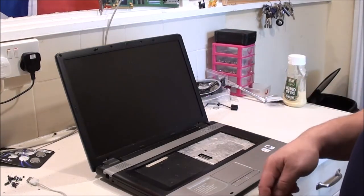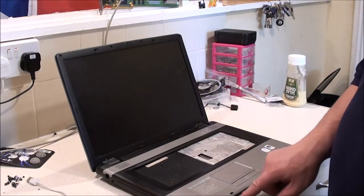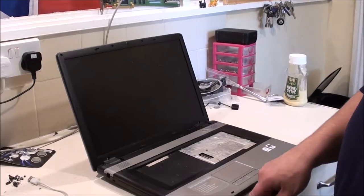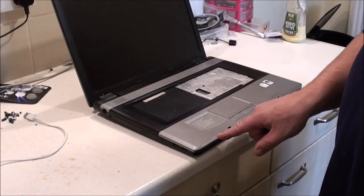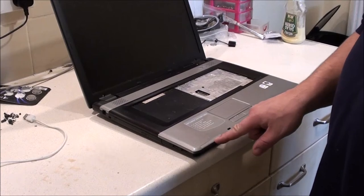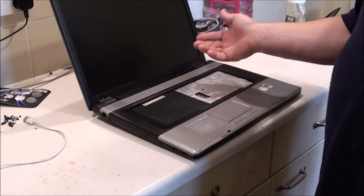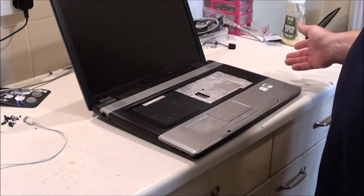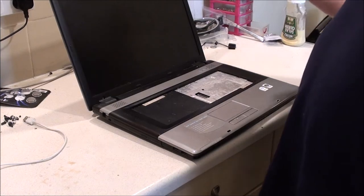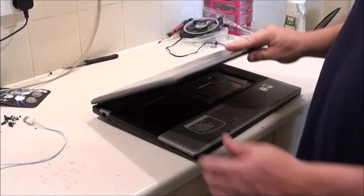If I shut it off and then turn it back on, especially via the button down here on the front panel, I get the power light, but then I get the num lock and the caps lock lights on as well. And pressing the keys on the keyboard does nothing. Even plugging in a USB keyboard does nothing. So I'm thinking that there has got to be a motherboard issue on here. Could be a dead processor.